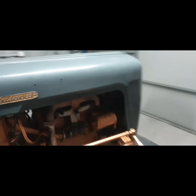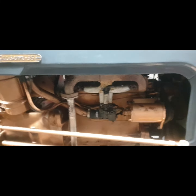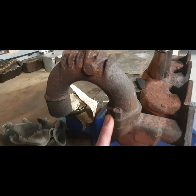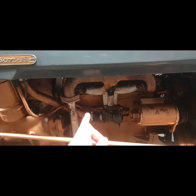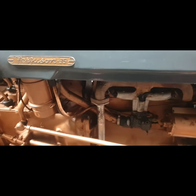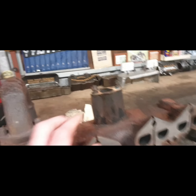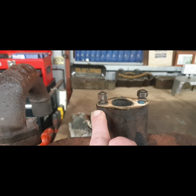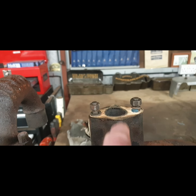My last video was about trying to get some air leaks sorted on the intake side of things. For anyone who's watched these videos further back, because I couldn't get the u-bend off, I went and raided my part stock and I had this exhaust manifold and I used this one with the underslung exhaust. My issue — one of the issues I have on the other manifold, and this one as well — is this flange here isn't flat, and the carb is then buckling a bit with a gap in the middle.